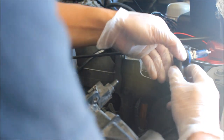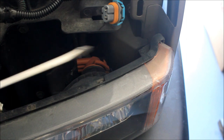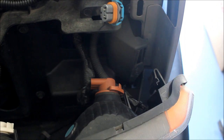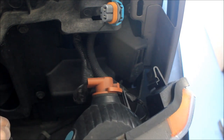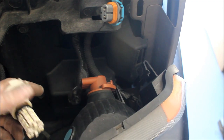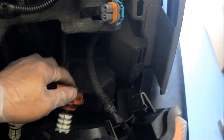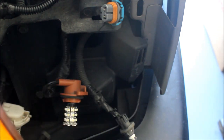We can keep on working on the truck. Next we're going to bring out our other tool — a bigger flathead screwdriver. I'm going to push that pin in and pull this out. You Dodge guys must be hating me right now. You saw me do that plow video on that 2012 Dodge Ram 2500. These are LEDs, so it's okay if you touch them a bit, but just for practice sake I'm going to keep my gloves on. Those lights are a pain to take out — I'm pretty sure I can take apart this whole front end before someone gets their first headlight housing out of that truck.